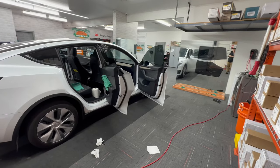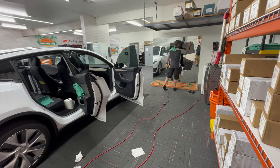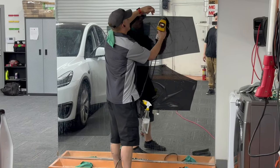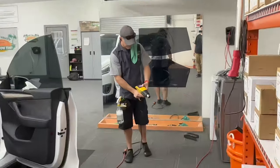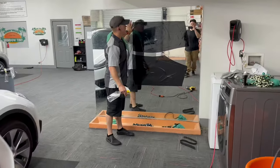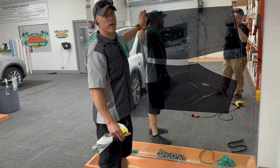So is that true, that ceramic at a certain point of the year, the heat rejection will get lower and lower? This is actually on one of the 3M websites. That is the biggest reason why crystalline over ceramic. Crystalline's not going to do that. Ceramic is, because it doesn't matter which manufacturer you buy from, any of the big guys, 3M included. This is a hybrid film. Correct, this is an IR coating. Coatings fail. Put a coating out in the sun, it doesn't matter what kind, eventually it's going to fail.